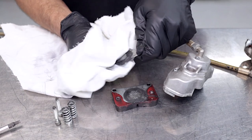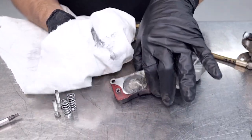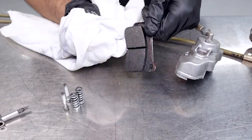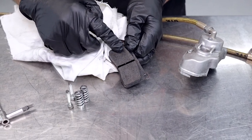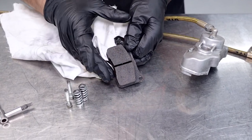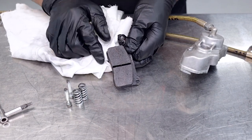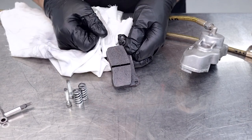What you can do with your old shims is just clean them up and keep them as spares because we are going to be putting in new brake pads. These ones have been contaminated with oil and they wouldn't be much good — even though we could clean the brake face, the oil soaks into the porous material of the brake pads and it's going to give you less than awesome braking. So these ones in the bin, brand new set going in.